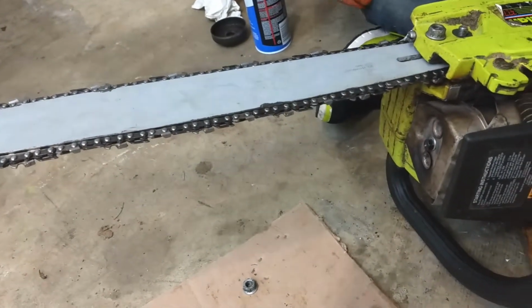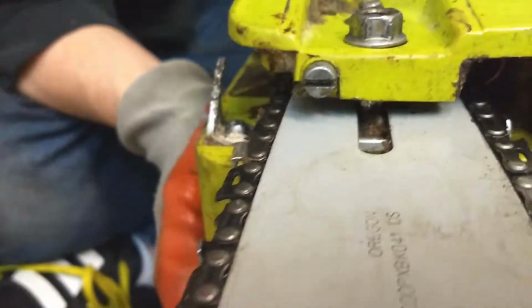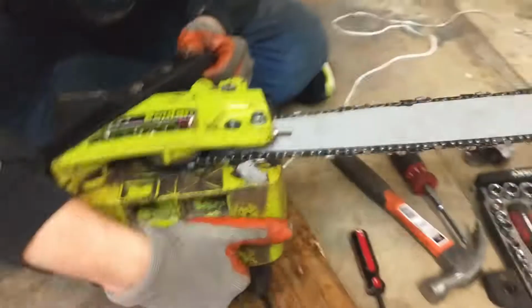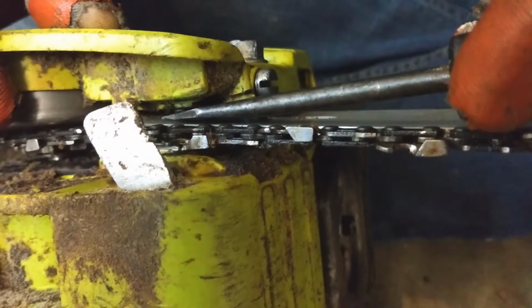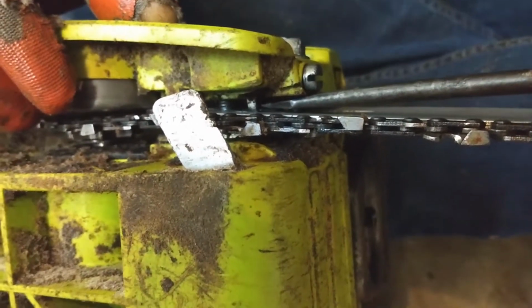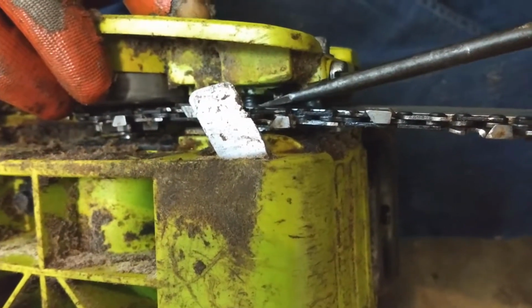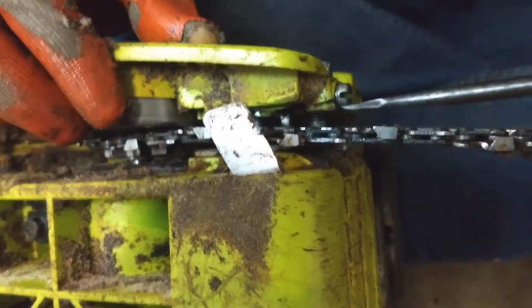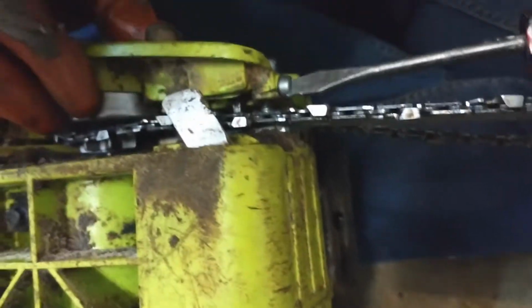There's also right here. See this screw? Okay. I'm gonna flip this around, so just watch yourself. In here, you may be able to see it. Do you see right here? There's a little metal stud right there. Yep. I'm tapping against it. That metal stud needs to align in a hole that's right here. You can kind of see the light shining right there. So you need to get those two to line up. Okay. So just turn it until the bar ultimately starts fitting in place.